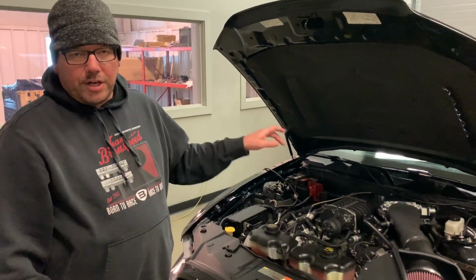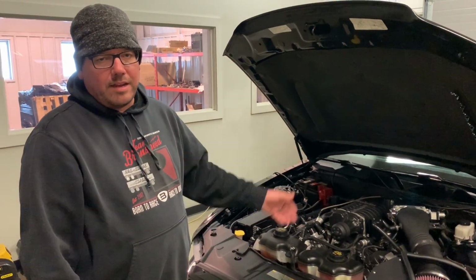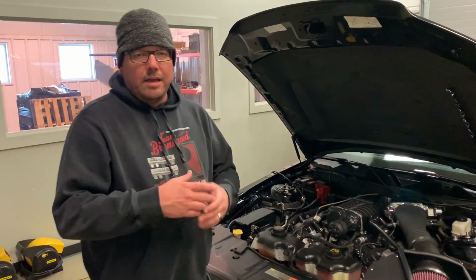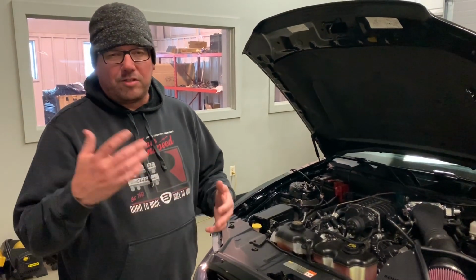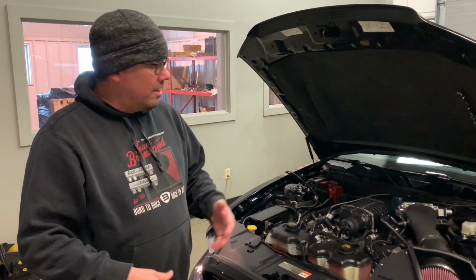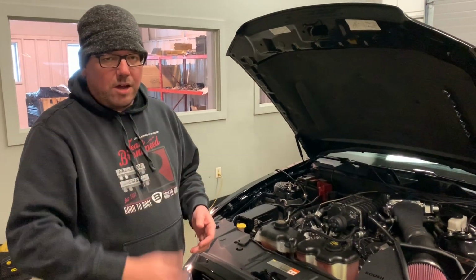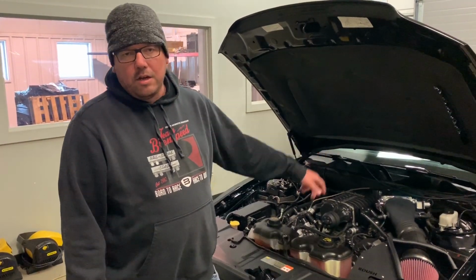The oil separator by JLT helps catch the oil, keeps it from going in, you won't degrade the octane, and it keeps your throttle body clean. So a lot of you maybe had, your cars ran perfect for a long time, and then all of a sudden you had a little bit of stalling or a really low idle. You pull your inlet off and there's a little lip of oil in there. You can clean that out. Well, you want to prevent that, you run that oil separator. I'll put a link to that at the end so you can read a little bit more about it.